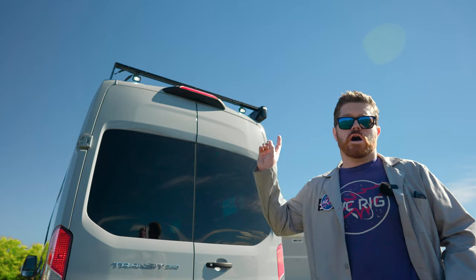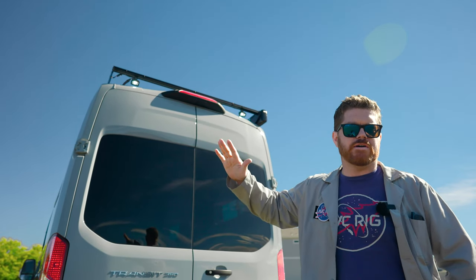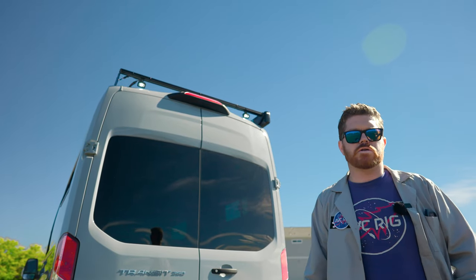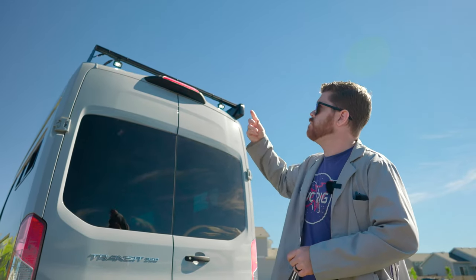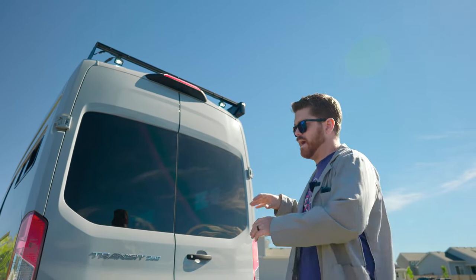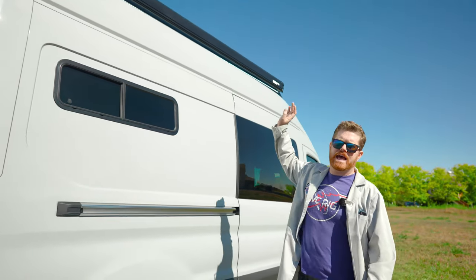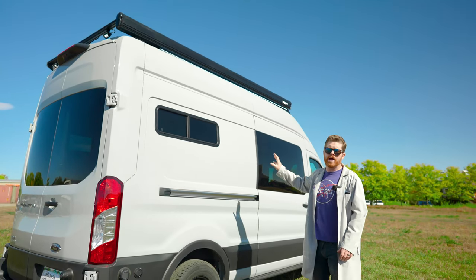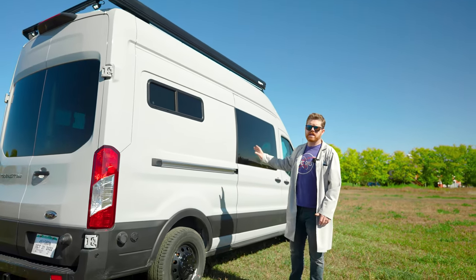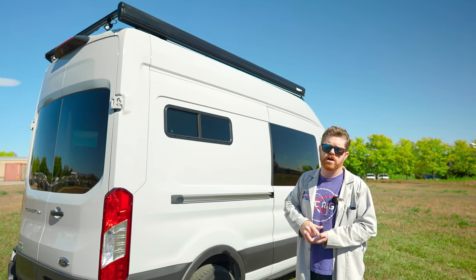Let's take a look at some of those LED details. On the driver's side we have two flush mount LEDs with a custom 3D printed AVC chamfer. We push those LEDs down about 15 degrees just to cast more light down below the side of the vehicle. At the back of the van we're utilizing that extra six inches on our roof rack 2.0 to mount two pod lights so we can cast a lot of light down here in the back of the van for loading gear in the dark. The passenger side has a Fiamma F45 3-meter awning with the Fiamma lighting kit, wired in with the Code 4 LED lighting controller — all at the tip of our fingers and controllable from our smartphone.